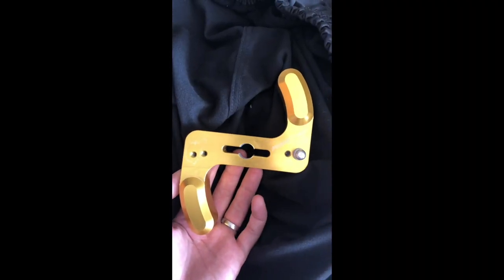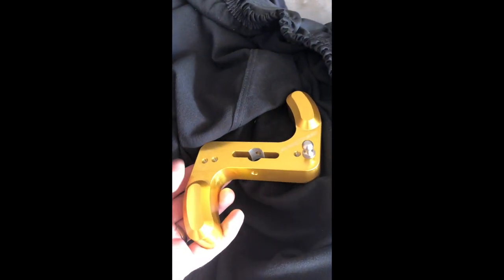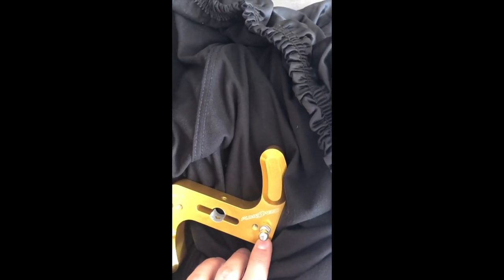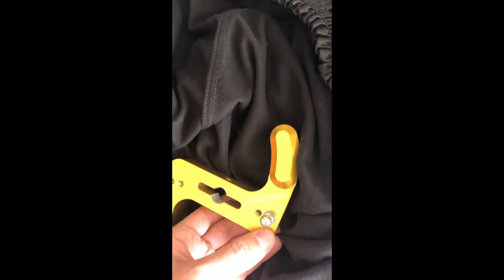I've had a chance to see what the different hole settings on this swing arm from PumaSpeed get us. Position 1 gives us a 24% reduction plus 25mm extra forward shifting. Position 2 is 39% plus an extra 25mm forward shifting. Position 3 is a 40% reduction. Position 4 is 25% reduction. I've switched from position 3 to position 4 — I think 40% is a little bit too much, and I hear that 25% is pretty much spot on.